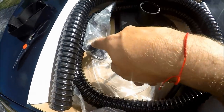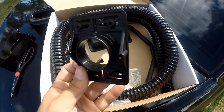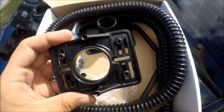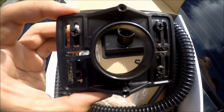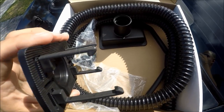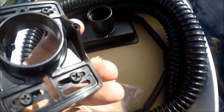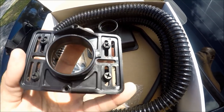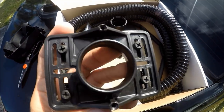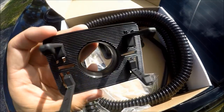What you're going to want to do is get whatever little tab is going to fit your vent, pre-fit that into your vent. Now, if you have a Crown Victoria and want to get this for your Crown Vic, set it up the same way I have it. You're going to want to set it up on the inner brackets. I used the medium tabs because that works best for the Crown Vic. The way we install this: it comes with four little screws. You pre-screw the screws into these slots, and the tabs on the back have holes — you just screw them into the corresponding screw.